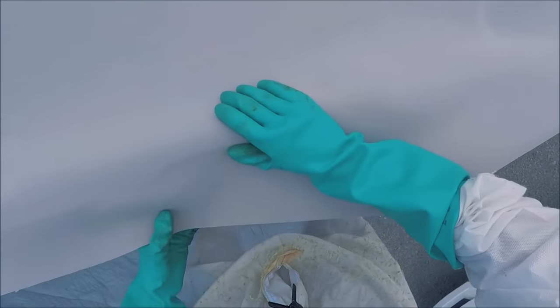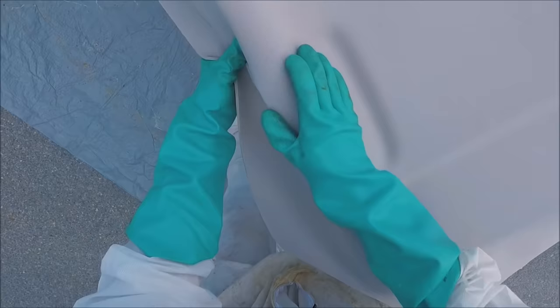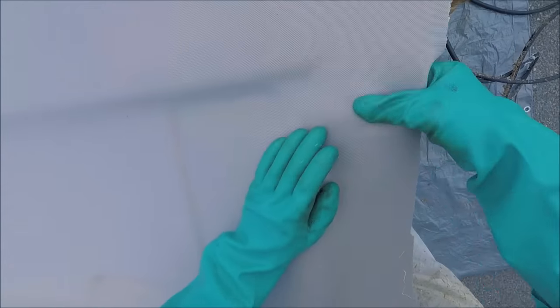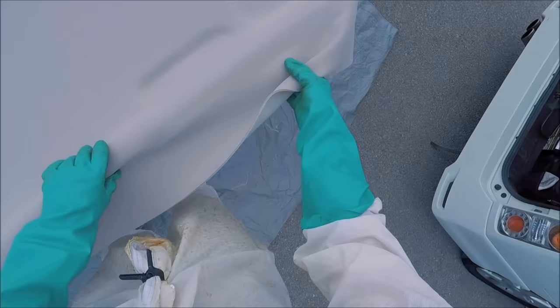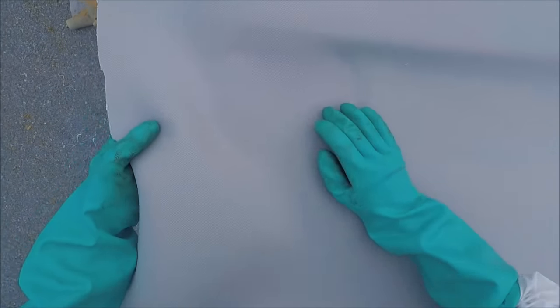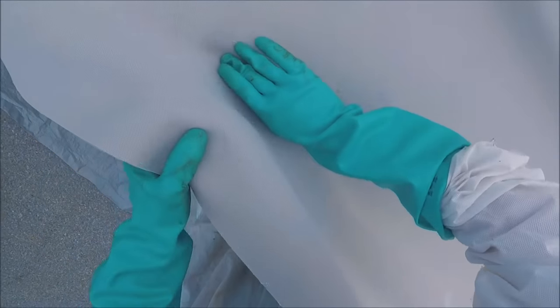This is looking pretty good so we'll keep applying the material. One thing we do is overlap the material around the edge. From factory, most cars just laser cut the material right to the edge — that's why headlinings start to sag there because that's where the sun and wind get in. So we always overlap all the material; it provides better adhesion and it's never going to sag from the edges again. Don't razor cut it straight to the edge like the factory — just overlap it all.